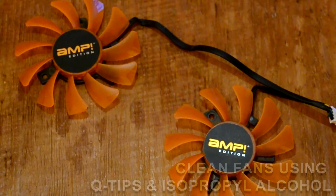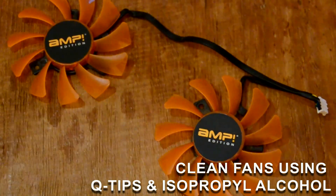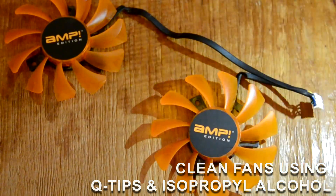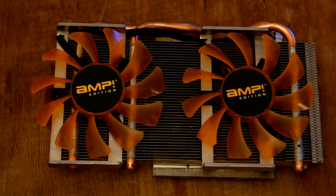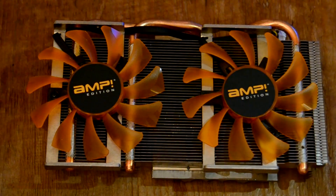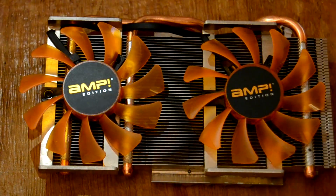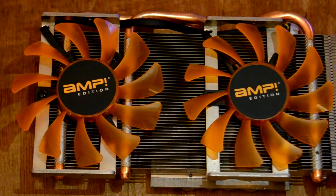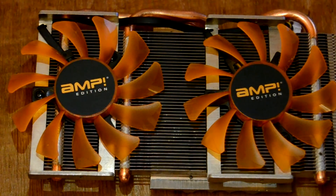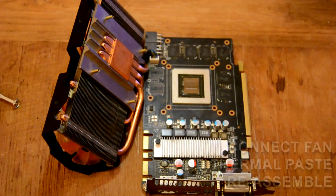The fans were by far the most fiddly, with each fan requiring a small nail scissors to cut out all the hair which had become tangled. Each of the fins were cleaned up using a q-tip and isopropyl alcohol to remove all the dust and grime. Once completed, it was immediately noticeable — simply by spinning the fan with your finger — that there was a lot less resistance than before. Everything nice and clean, it was time to screw everything back together, ensuring good fan clearance to the heatsink to eliminate that tick tick noise.